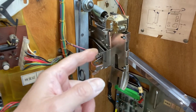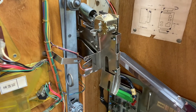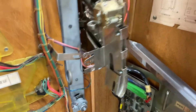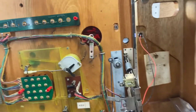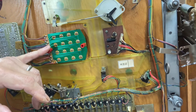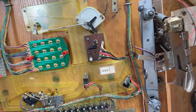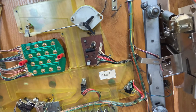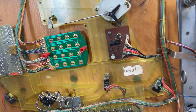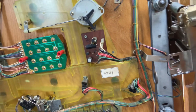There was a micro switch here that went into this little slot. I just couldn't get it to work, so I took the two wires that went to that micro switch and routed them up to a push button. This is the board that has the lights for numbers one through 16. This is a very cool machine — it's a buffalo, and the horns open and close. This is the stepper motor that opens and closes the horns. From talking to a couple of people, that's very rare to find one like that, and even rarer to find one that actually works.